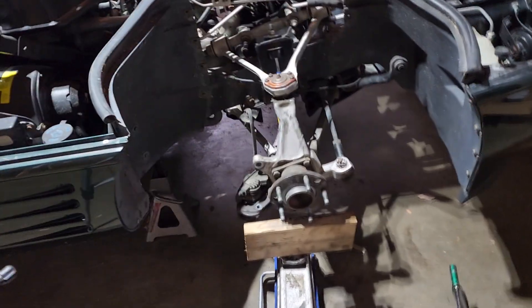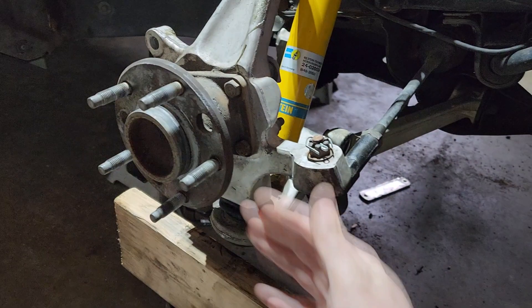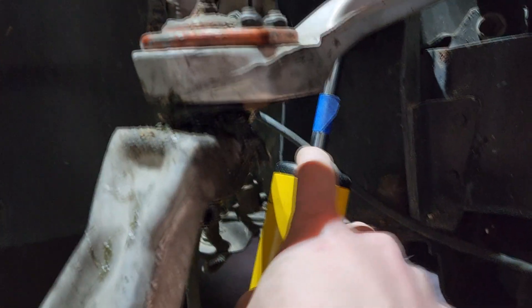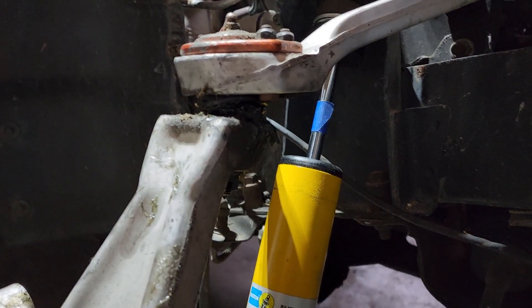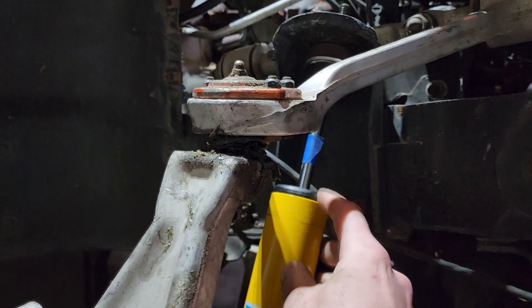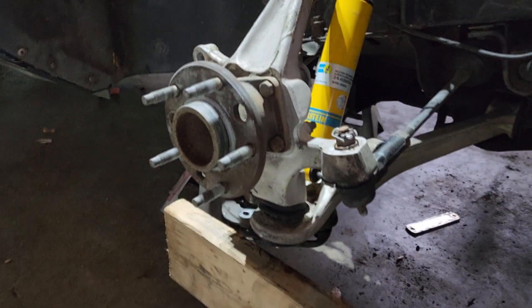Using the shock motion ratio will be covered in Part 4 when we're dyno-tuning the Viking Crusader shocks, and look for Part 5 after that. To find your shock motion ratio, you essentially measure two things: the distance your shock moves, and the distance your wheel — or something your wheel is attached to — moves. As you can see on the front shock, I've got a piece of tape there. I'll measure that distance, then move the shock that exact distance by jacking up on the arm.